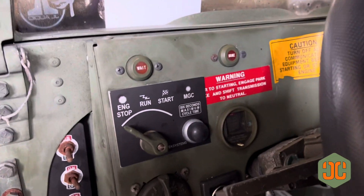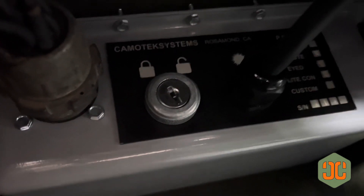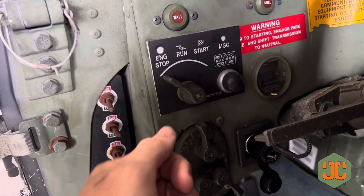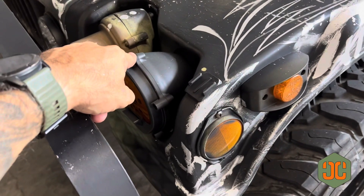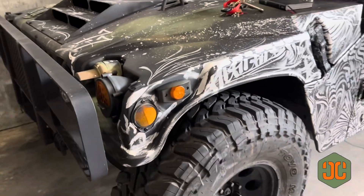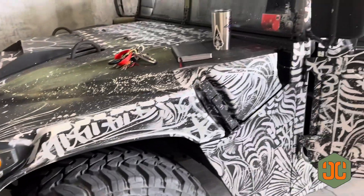Some of the upgrades I opted for when ordering from Camo Tech: I got this remote switch on the dash instead of pushing a switch right on the box to heat up the glow plugs. I got the keyed box so I can just kill power, and there's an optional feature where when you kill the truck it kills the lights too, so you don't have to worry about someone forgetting the lights on and draining the battery. Cam's also got this cool thing that integrates the side marker light to the turn signal so cars next to you can see you're about to turn. Very stoked on all this — heading to Italy for Death Race and some workshops, and when I get back the interior is getting done and this all gets installed. We'll be back to working on this thing!